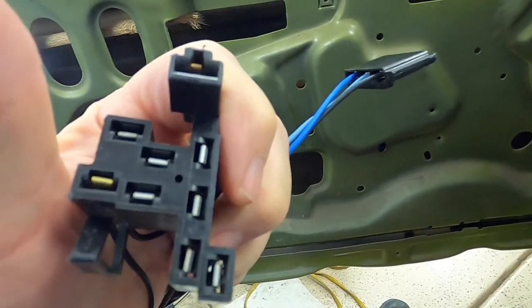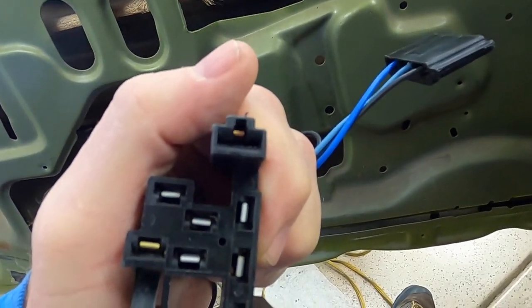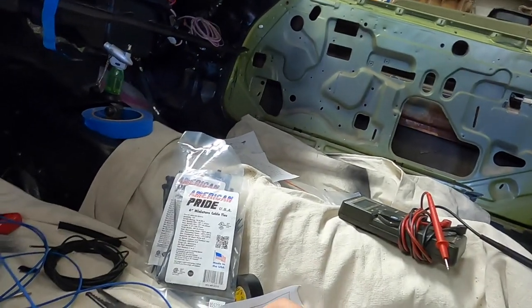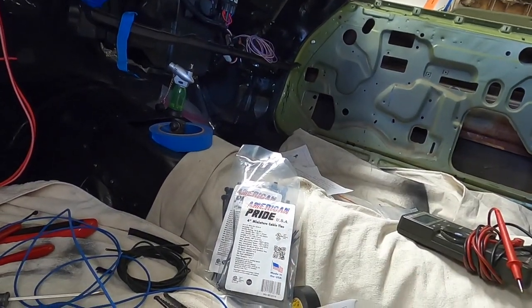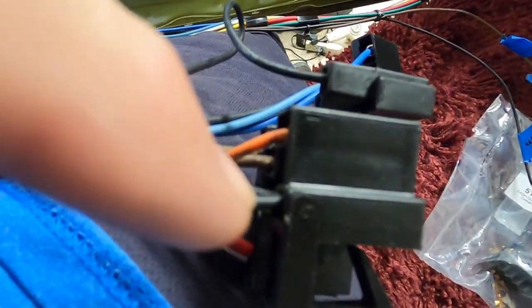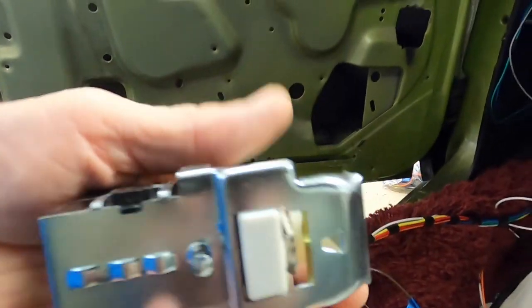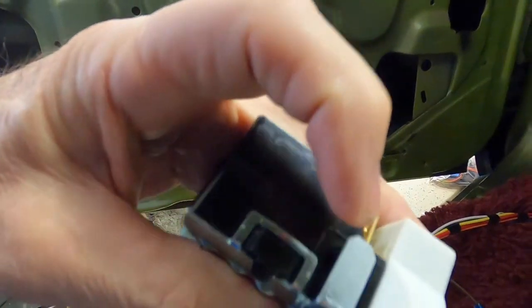You can also get a newer-style nine-pin female, which will be a 59-series connector. So why does my connector have an extra terminal? Most standard headlight switch connectors are generally eight-pin, and that ninth pin connects to the side here and provides a ground. The ground jumpers off of this and this wire goes down — so you ground this wire, it jumpers down to here, and that grounds the housing of the light switch through this lug right here.